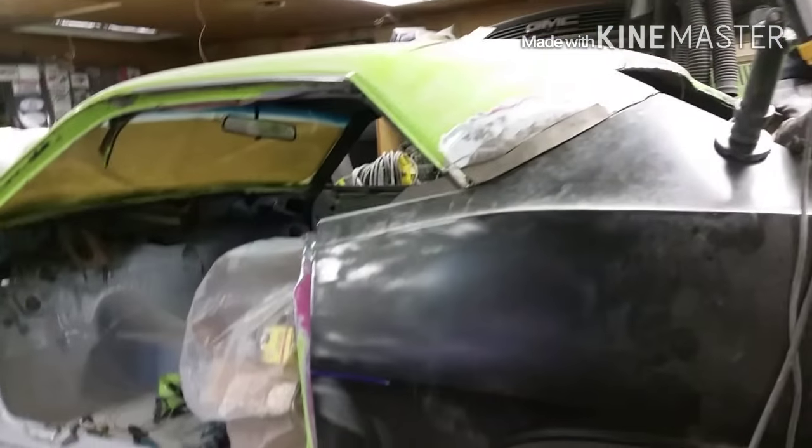Sorry guys, I've been remiss hitting the record button. We're chugging right along. Besides working on the door, I'm doing two things — making up a patch for this area. I don't know if anybody remembers, but it was kind of rotten up here a little higher, so there really wasn't anything for the lip to weld to. The advice I got was to just weld a piece of metal right across that, treat it like a patch, level it out — there won't be as much filler that way. So I needed to make a patch here, and that's what I'm doing. For those guys who were asking about cutting patches...